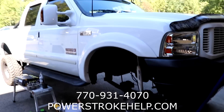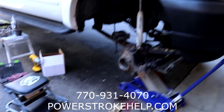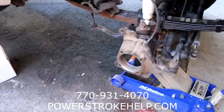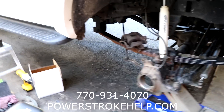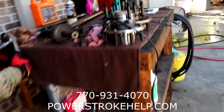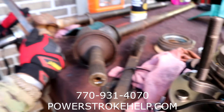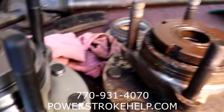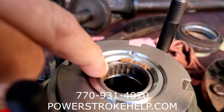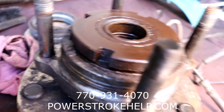So yesterday we're riding back from our film session on this truck and this right front hub started making a funky noise, and I'm thinking, oh my goodness, it's got a bearing going bad. Well, it wasn't what you might have thought. So Dennis, this bearing is about three years old - a Moog that you had on here. And you said your wife had somebody put it on the truck? What happened was inside here where the axle goes through, there's a little roller bearing. If you don't grease that thing up real good, it will go hot on you and tear your axle up right here.